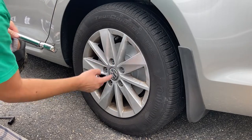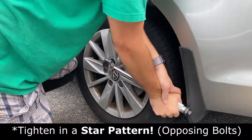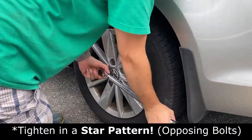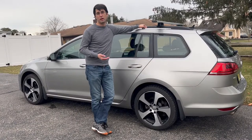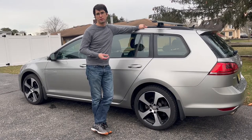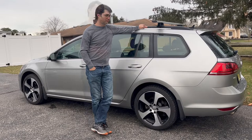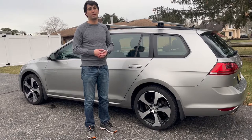This is a 17 millimeter socket. Torque is 80 foot-pounds. Use a star pattern. Thanks for watching this video and I hope it gives you the confidence to do this job yourself. I think this is a fairly easy job for a DIY enthusiast, especially someone that works on their cars, and I highly recommend doing the service yourself. As always, I appreciate your support — please subscribe and follow and I will see you next time. Take care.